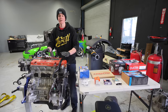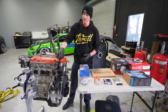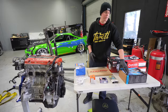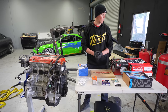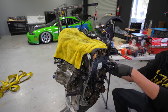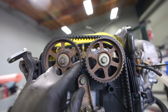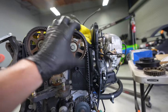We're going to take the valve cover off and hand it off to Ricky for a full repaint to make it look brand new. While he's doing that, I'm going to start doing some basic maintenance — we have a new valve cover gasket going on because it's leaking, and that seems to be the primary leak on this engine. We're going to be doing a full timing belt so this does have a water pump included. We're going to make sure all the cam seals and crank seals are in good shape. The intake cam is actually off a tooth — this means the cam is rotated one tooth this way, so this car should run a lot smoother, make more power, and be more efficient once we've corrected it.